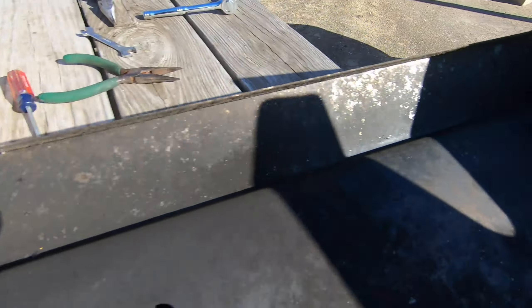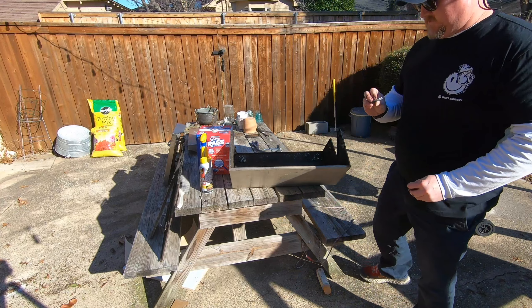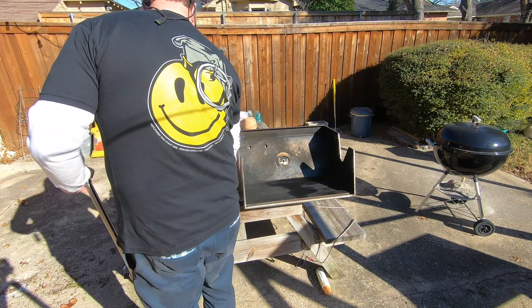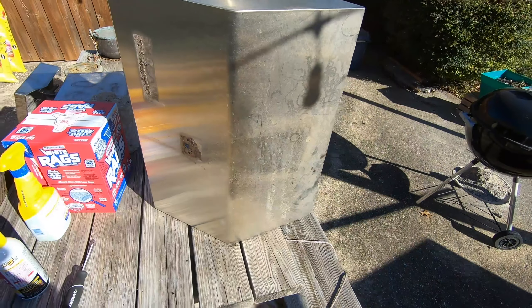These retaining clips — I think we can just find them at a Lowe's or maybe order them off Amazon. We're still going to keep them so we have them for reference. Bag your parts. The last little part we need to take off the hood is going to be the handle — that's just four Phillips head screws: two there and two over there. Should be a little easier than that thermostat. Interesting, there's like a little filler cap that goes inside the handle. Easy peasy. There's the handle. Don't forget, bag your parts. That is the lid completely disassembled. Thermostat's gone, front logo's off, handle screws are gone. She's going to look a lot better when I'm done with her.